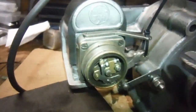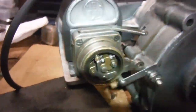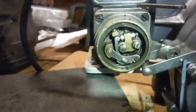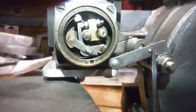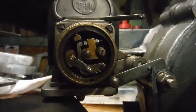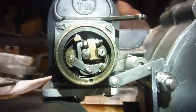So I can now snip the cable tie and we'll probably see it spring back into its retarded position. There we are — that's now fully retarded. You'll probably find the points will open at or around top dead center now. Let's bring it up towards top dead center and watch those points.